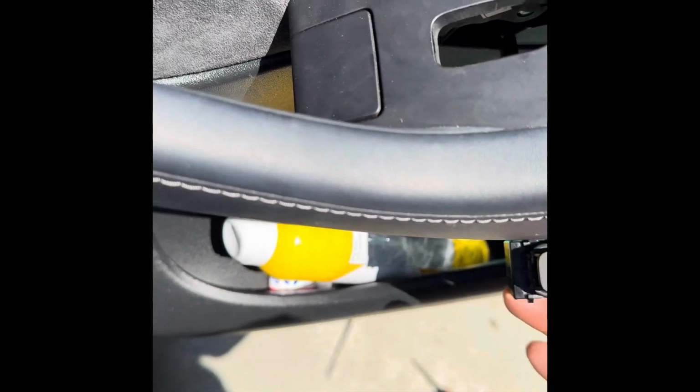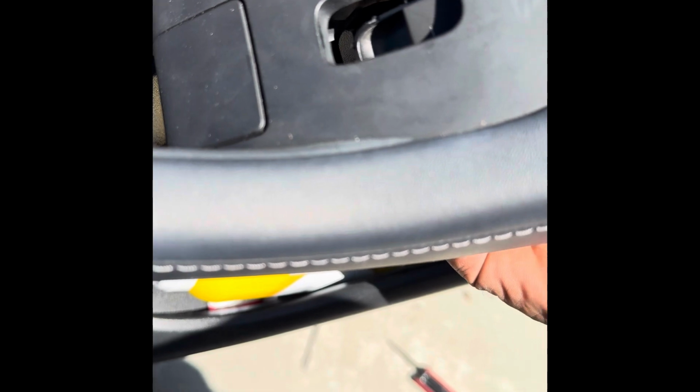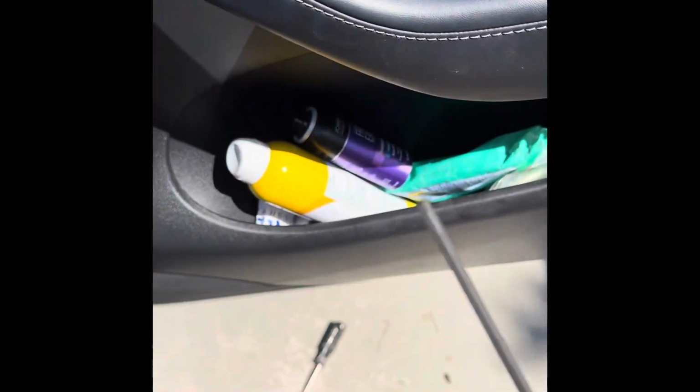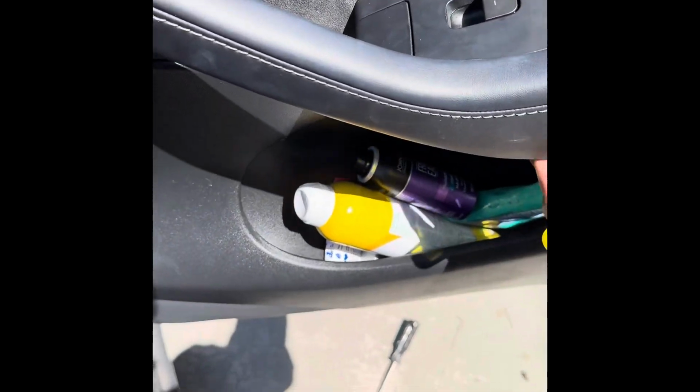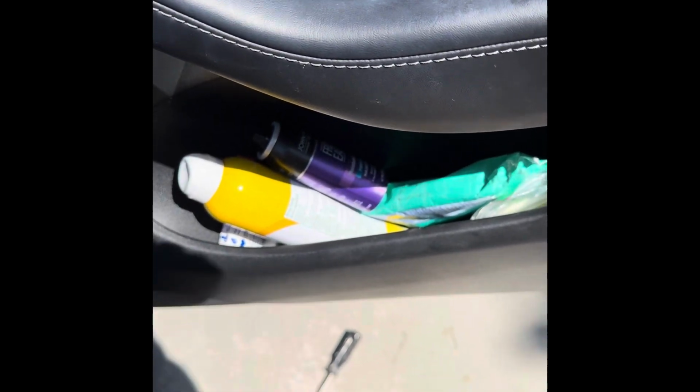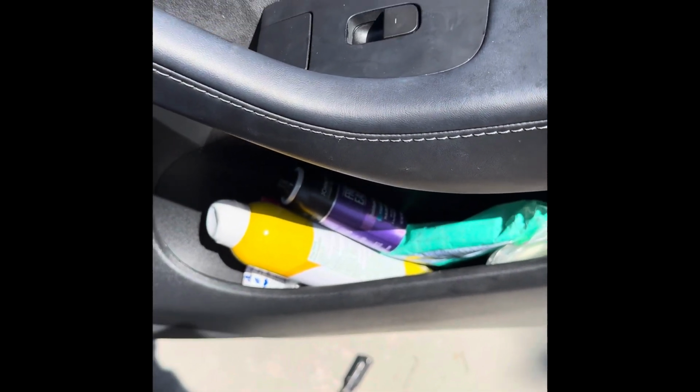Now you've got to just pop it back into this slot right here. Fingers coming through, and you just take it and put it in, turn it around, and you just got to work it. And there's some slots back here, and there you go. You heard it click. It just clicked in. Now the key to this is having the right hex wrench, the 5/32, to get the screw out from underneath, and a very fine flathead to move the tab to get it off of one switch, so that you can put the new switch in.